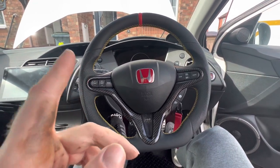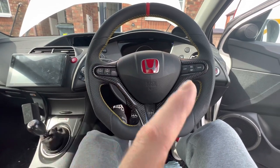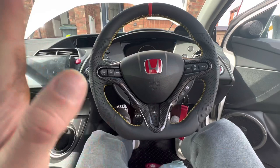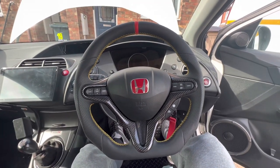Checks to do now: just reconnect your battery, make sure your horn works, make sure all your functions work, and make sure you've got no airbag warning light on. If not, you're gold. Thanks guys!